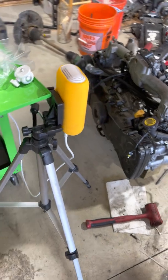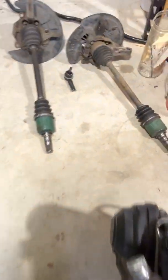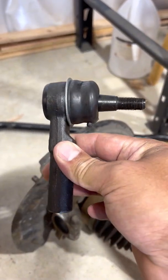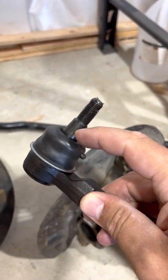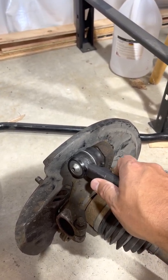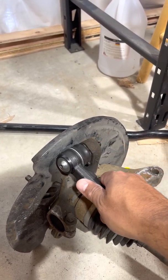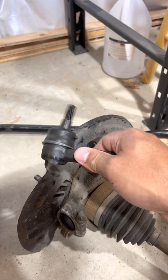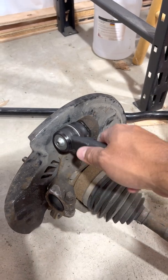I haven't scanned much lately because I've been working with this other stuff, but you can see, oh, there's the tie rod ends. Here's one of them that I was looking at. This one is a decent length that I could use with the factory inner. I believe it would be long enough still, but this taper was just a smidge off. It comes in here and sits and it rocks. So you know that it's hitting on the big end, but the small end's not in deep enough to get you seated on that taper. Options for that are you can buy reamers to establish the correct taper for this. But again, that's modifications to the car I'm trying to avoid. I'm trying to make it as plug and play as possible. So this one is a no-go.